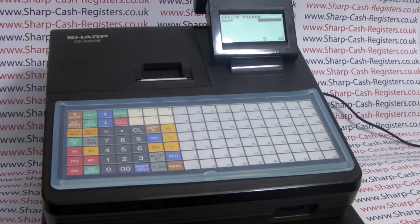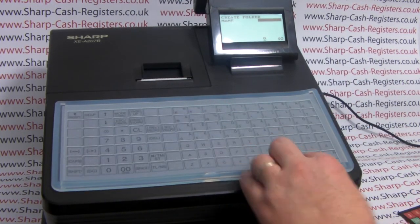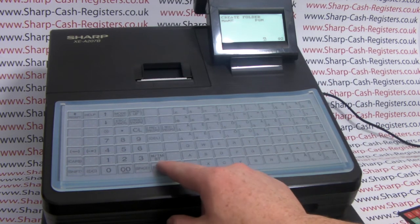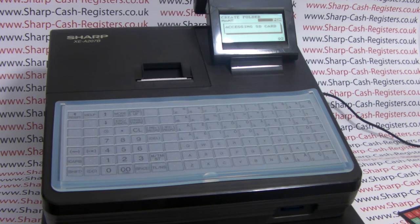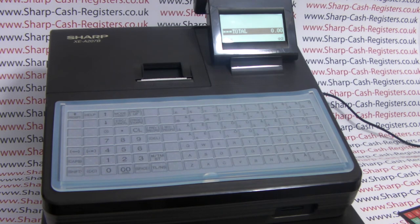If you're using the retail machines, the 207 or the 307, you can simply type in the name. On the 217, the QWERTY keyboard is underneath the master keyboard so you have to remove that. We can then give our folder a name — we'll call it PGM for program. Press TL&S to save, then press TL&S again to confirm. Once the folder has been created, press escape/cancel to return to the main menu and remove the SD card, which we can now use in conjunction with the software to program the cash register.